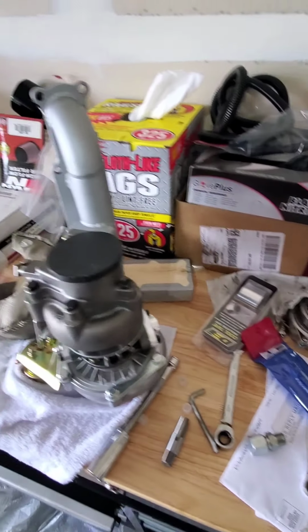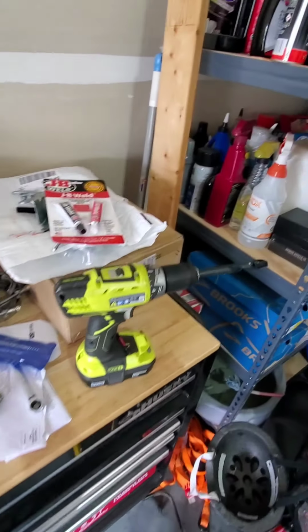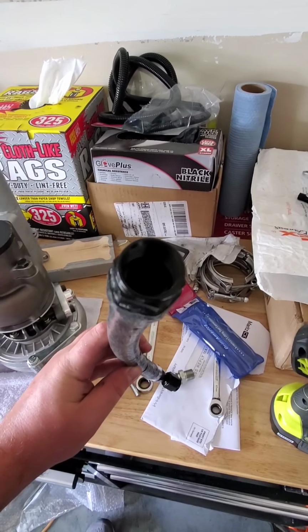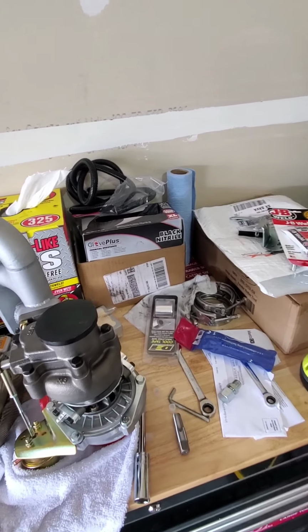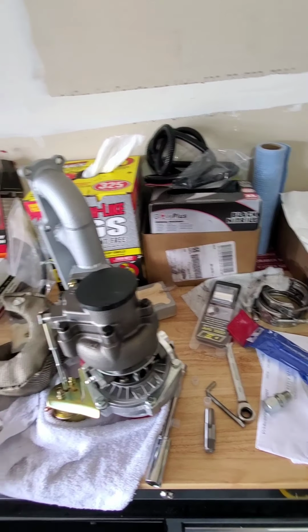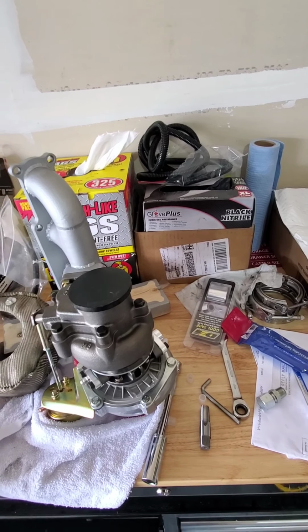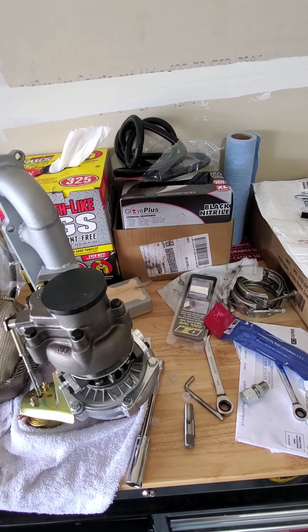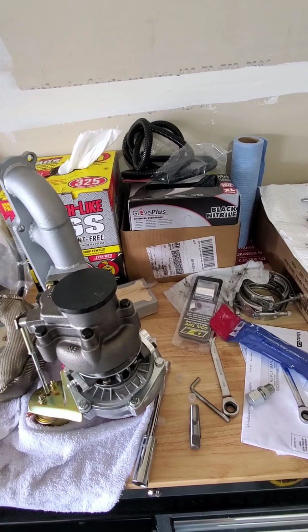And then, just to make sure, I have some leftover oil from my last change. I think I'm going to hook this line up to the drain and use a funnel to run some of that fresh oil down this, to hopefully run any shavings just inside the hole on the wall down into the bottom of the pan with the rest of the oil. And then when I drain it, hopefully I'll have all the shavings.